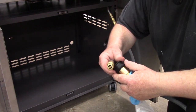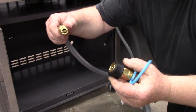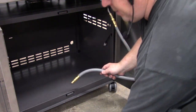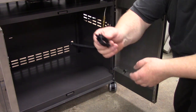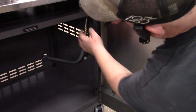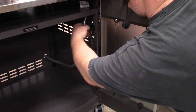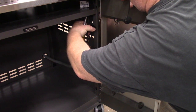Here's the natural gas hose. This quick-connect fitting goes to your gas line so you can easily unhook the barbecue. There should be a shutoff valve as well. Route the hose through the grommet in the back — pull it through that spot. The wire harness also has to be clipped in, so wrap it around and push it in to clip it into place.